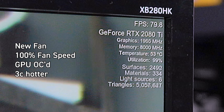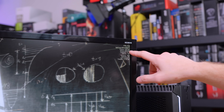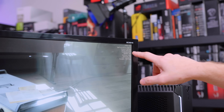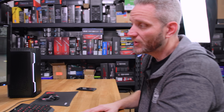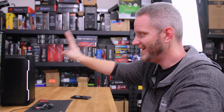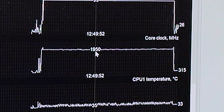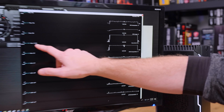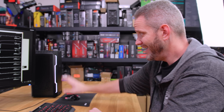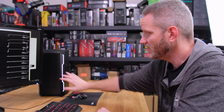After about another 20 minutes of looping with our overclock, we pushed the memory over a thousand megahertz overclock, running around 2050 to 2100 on the actual core, with a max temp of 53°C with the fan at 100%. We've traded some acoustics but with the hum of the air conditioner it kind of blends into the room environment. Our clock speed stuck at around 1985 MHz — it started at 2145 but came down due to temperatures — sitting just under 2000 MHz in this small form factor. That's what makes this absolutely insane: this level of overclock and these temperatures in this form factor.